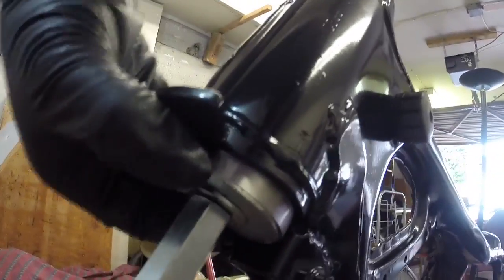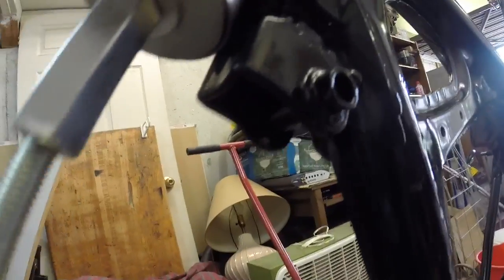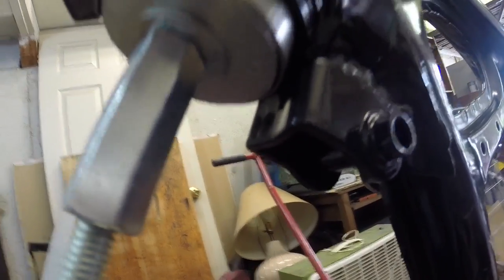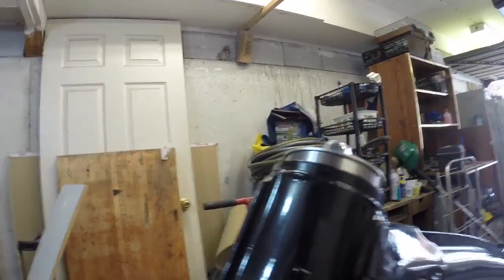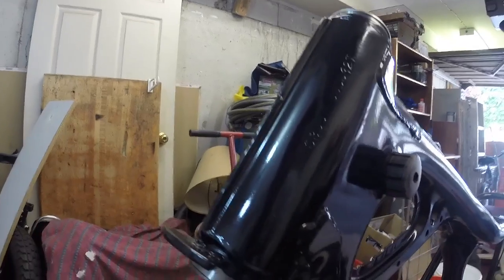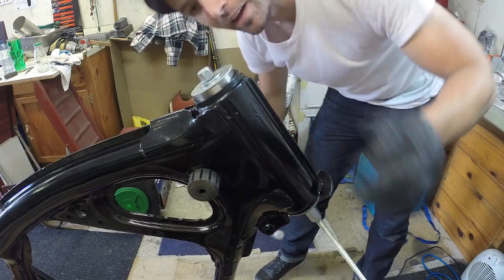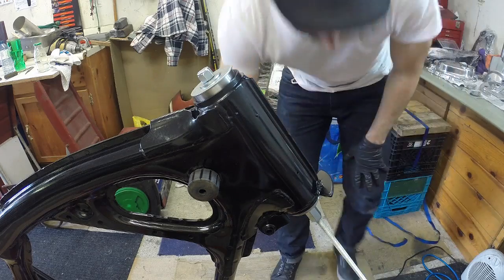So you can see my linkage tool here, and then I have my washer sitting as flush as you can get it with this race. The race looks more or less pretty straight. You can see the top one. So now the idea is that I'm just gonna keep turning this and I'll squeeze them in. So let's try it out. Looks pretty good.